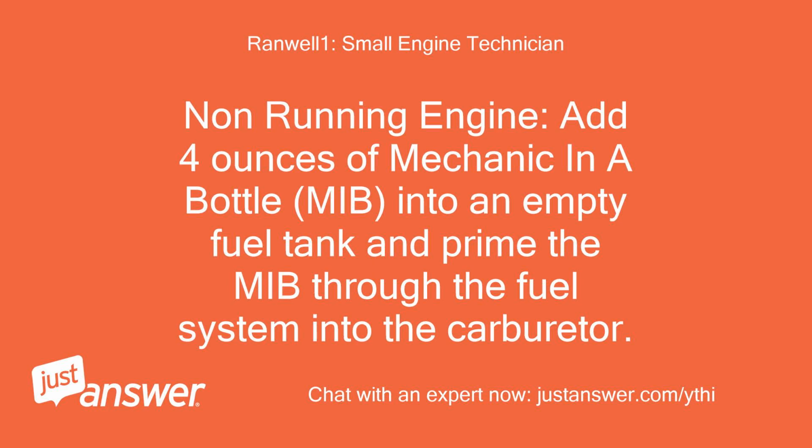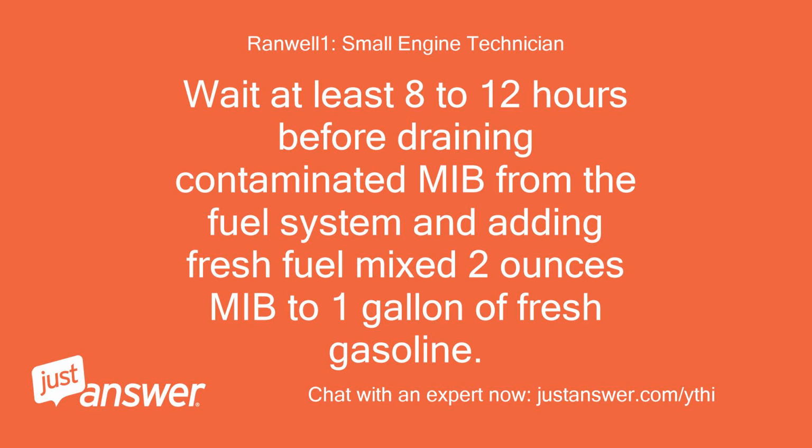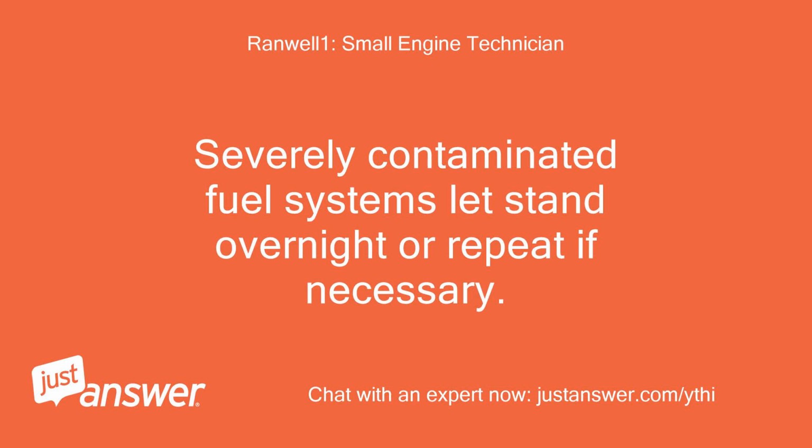Non-running engine: add 4 ounces of Mechanic in a Bottle, MIB, into an empty fuel tank and prime the MIB through the fuel system into the carburetor. Wait at least 8 to 12 hours before draining contaminated MIB from the fuel system and adding fresh fuel. Mix 2 ounces MIB to 1 gallon of fresh gasoline. Severely contaminated fuel systems: let stand overnight or repeat if necessary.